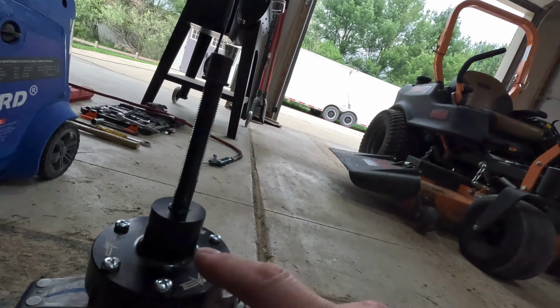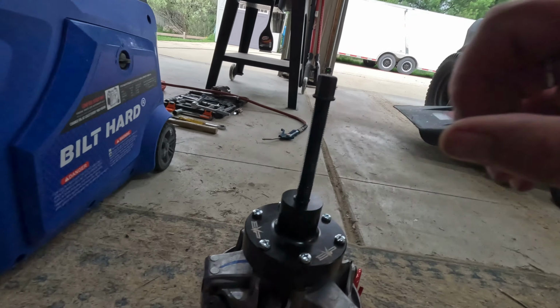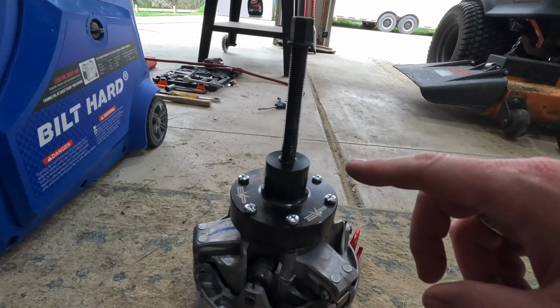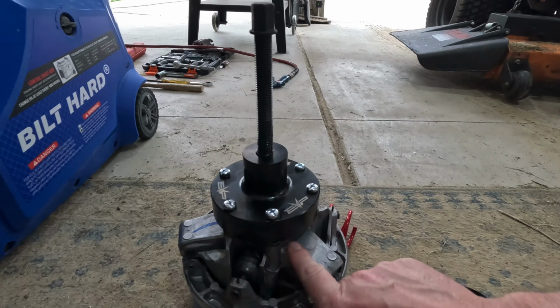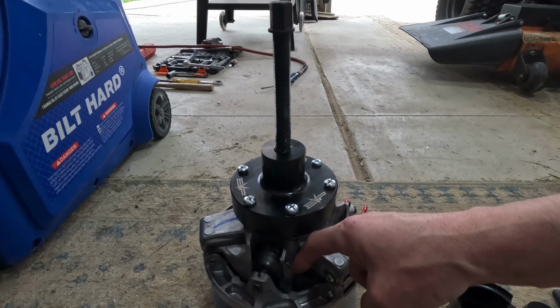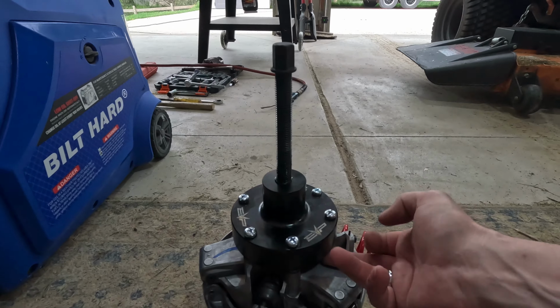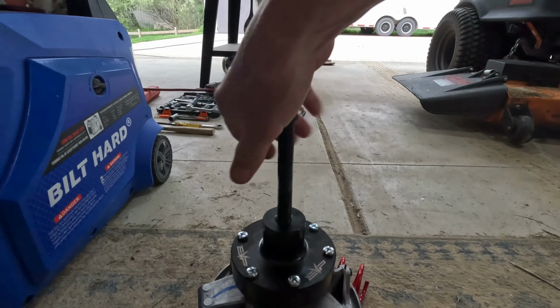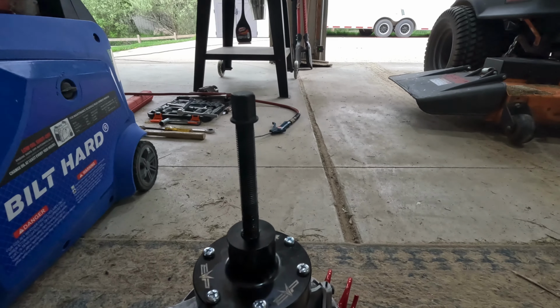So right now I'm going to go ahead and try to break the taper on the governor cap. So that actual top of the unit here, even though you remove the screws, that governor plate, unlike the Ski-Doos, is press fit to the actual center shaft. So you remove the stock bolts, then you put this hat on, put in longer M8s, and then with the actual clutch puller tool still inside, you thread down another one against that, and that'll pop that hat off. So we're gonna see how that goes.